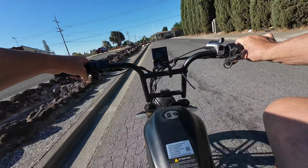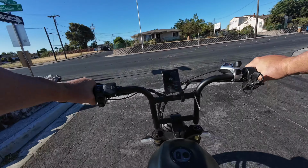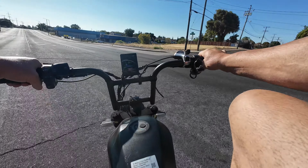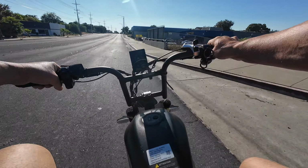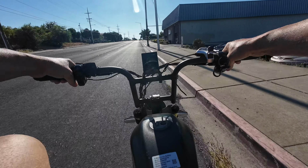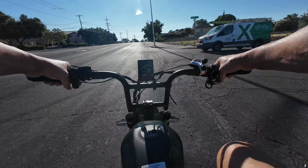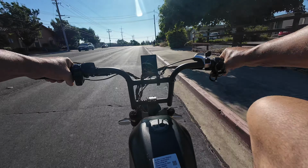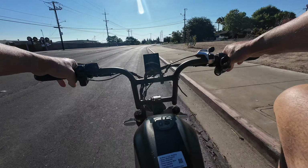Flying. Stop here. These brakes, especially since I changed the brake pads, they bite really strong. So I'll leave the link for the parts I use in the description of this video if you're interested in doing it on your bike. The stock rotors were just not handling the heat and warped easy, like I mentioned, especially the front rotor. I still have the stock rotor on the rear, but I think since you're not getting as much heat in the rear, it hasn't been much of an issue.